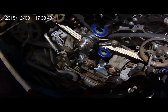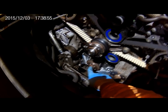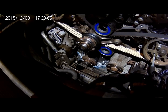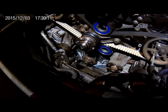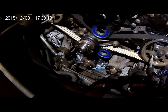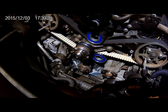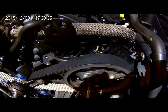That's the new belt on and the new bolt in the crankshaft pulley — it's tightened up to the required torque. Being an amateur, I didn't feel it was tight enough, so I went that little bit extra. Hopefully it'll never shift again. Now it comes to the rebuild — I'll start by removing the pins and reinstating the starter. Then I'll turn the engine over a couple of turns just to make sure that my marks line up again.